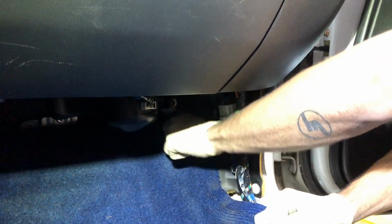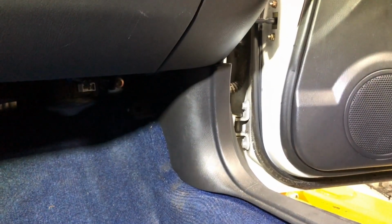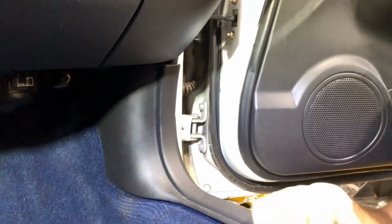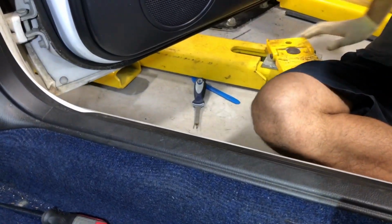The second one goes on after the plastic panel. So back that thing up. Then take your panel. Plastic trim time. So of course we're gonna come in here and kind of line her up. And you're gonna want to peek up under this panel to ensure that each one of these tabs lines up inside each one of these holes. Last thing you want to do is miss and jab the plastic. Yeah. And then break the tab. Just give her some taps all the way across the board. Send her on her way.